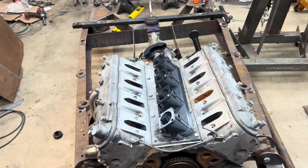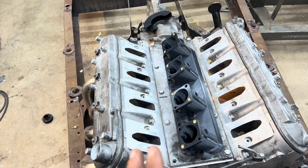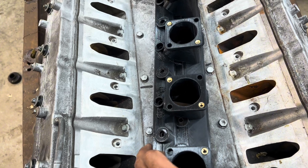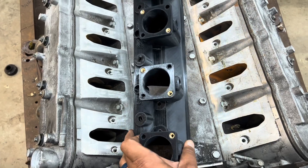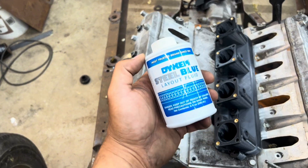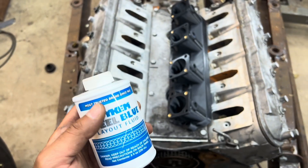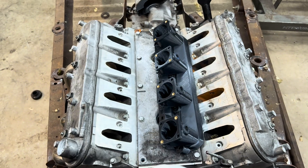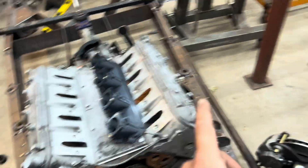So before we go into mounting our new throttle bodies and intake, I need to check a measurement. When I was drawing this in CAD, the bolt hole here didn't get lined up perfectly. So what I'm going to do is use some blue layout fluid — I'm just going to paint around the intake ports and then trace it out with a scribe so I can measure how far off my bolting surface is for this intake and adjust it in CAD. Then we'll move forward with installing those guys.